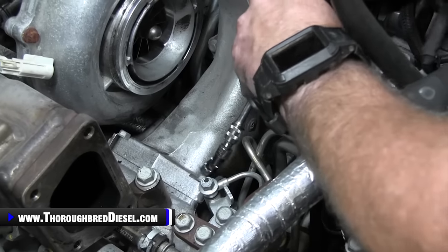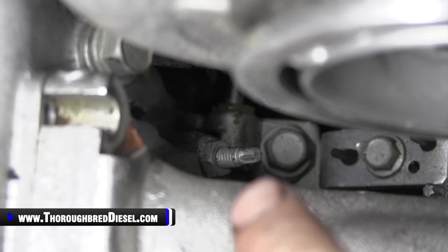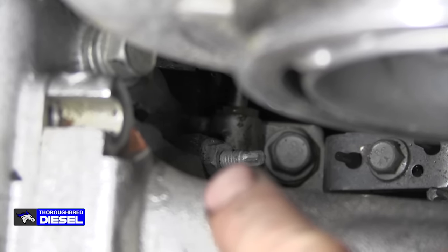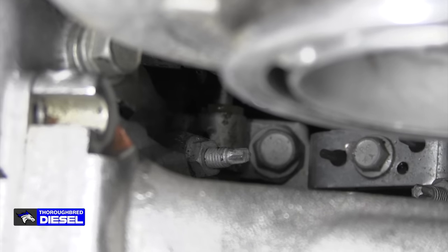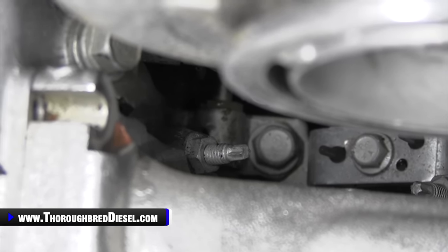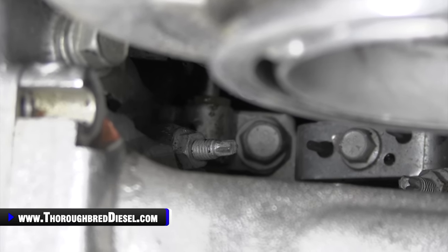So we're gonna go ahead and work to get the bolts out. While I'm talking this cross bridge, right here at the end of my fingers, the back two bolts for the Y bridge are actually nuts on studs. So when you remove them, you will have to use a universal swivel and a 10 metric deep well, and then a magnet to get the nut out.